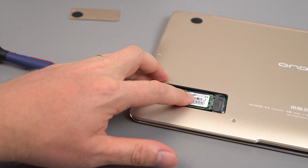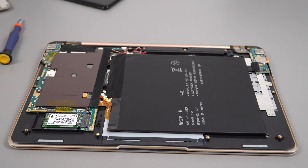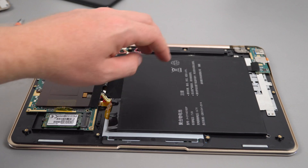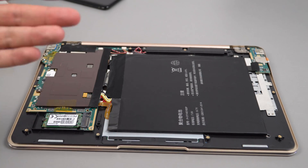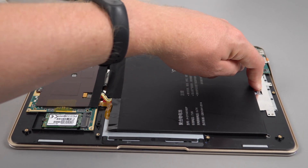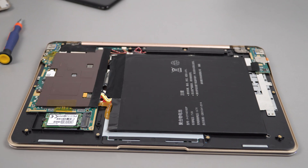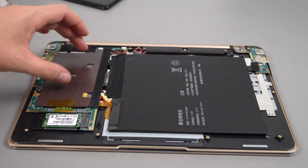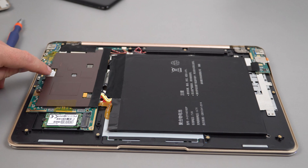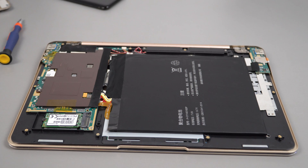It's great they've added these access slots, though I wish they had room for a 22-by-80 drive like they managed to squeeze into the T-book Air. Looking at the internals — there's a very large battery cell made up of what looks like two cells, an internal metal frame with plastic, the top metal palm rest and keyboard area are glued in. The two loudspeakers are located up at the top, so sound comes out from there rather than through the keyboard as I first thought. There's a large metal heatsink — good news for preventing thermal throttling. The Intel 3165 dual-band AC chip has dual antennas routed up into the screen area for good range.